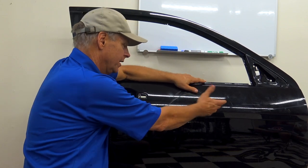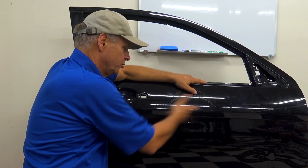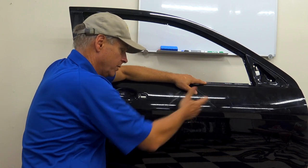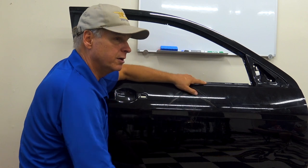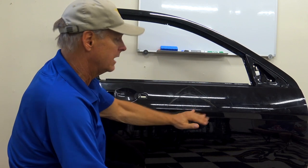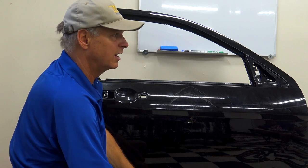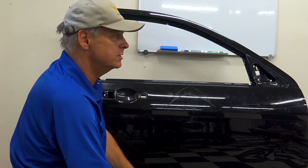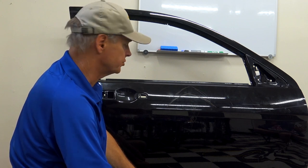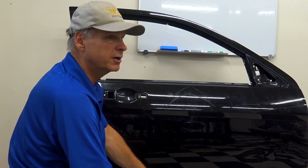So yeah, we would get the body line hinge worked out. Again, I would check for any pressure traps, 45 degrees, get your impact point, and just do the same thing that we did for something without a body line. But the body line hinge, guys, I see that. I mean, on the large dent repairs that I see, I will bet you I see a solid 80%, 4 out of 5 times, very, very solid, they left the body line hinge in it.